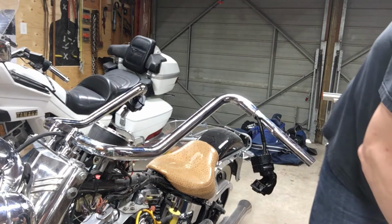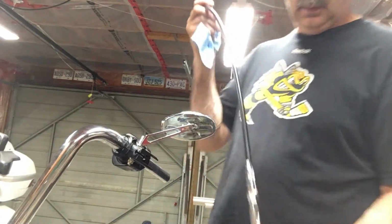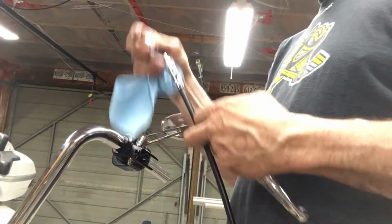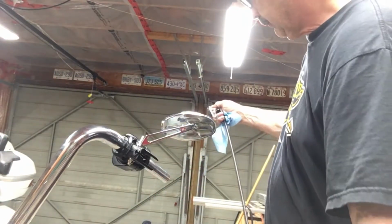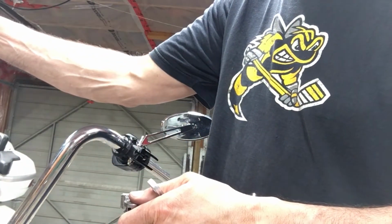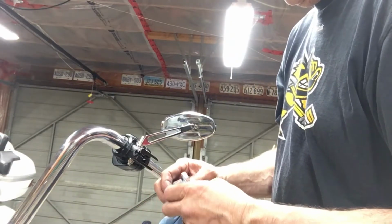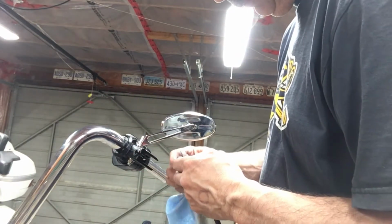Okay, that's the bad screw, that's the good screw. I'll get this set up back together. Okay, going to put the clutch cable back in. The clutch cables are extended 10-inch, but the brake line is only 8 inches because it's a straight stainless steel flex line, so it's going to run straight, whereas the original brake line went around all the corners. So it doesn't need to be as long. I kind of figured that it'd be shorter, and that's what I ordered, and I rough fit it, and it's going to be good. Let me just figure out how this all goes back together.